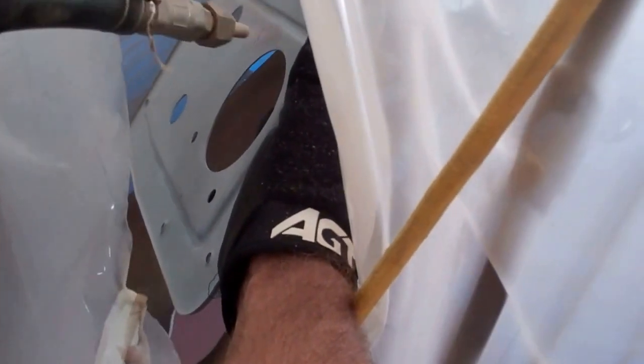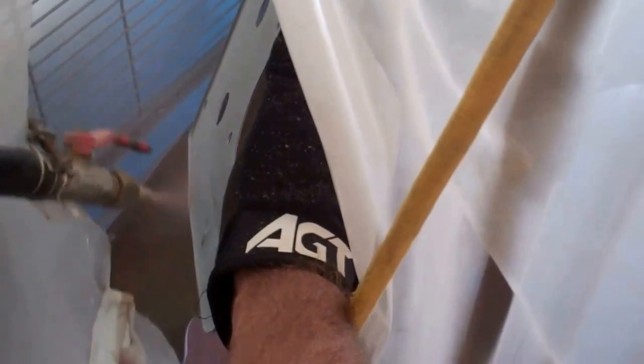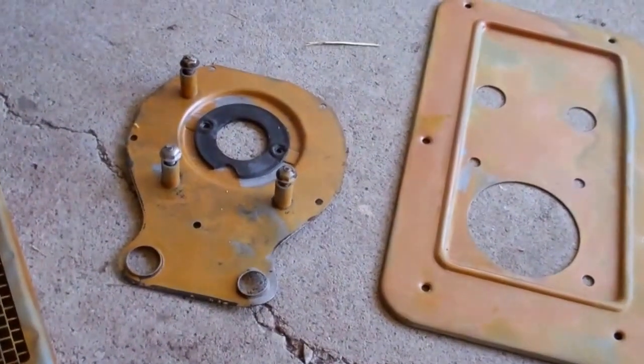Here's the heater unit - just blasting this and all the different bits and pieces on it. The outer casing is being blasted and I'll just clean that up now with the wire wheel. There's a lot of surface rust on the inside - obviously had a bit of a water leak there at some stage. I've had the action tested before and that's actually pretty good, so that's probably not the original core. The core itself is fine. I'll get these ready for priming and then painting in a semi-gloss black - going to have a nice looking heater unit.